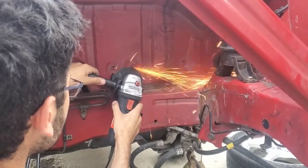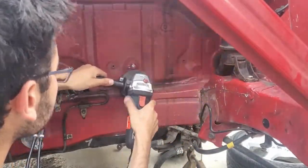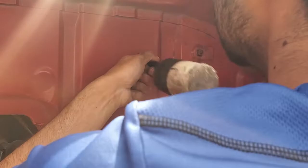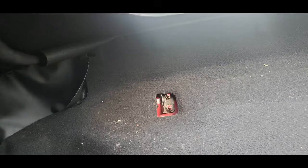And now the permanent modifications. First, you need to remove that small stud so it doesn't interfere with the motor. You also need to put a dent that is about five inches high from that stud — about three inches across and half an inch deep — to make it easier to service the alternator. There is also another area that needs to be dented in to clear the valve cover. You won't really be able to dent it in unless you temporarily remove the small latch on the other side. I'm not exactly sure what the latch does, but it doesn't interfere with the soft top even if it sticks out a bit.